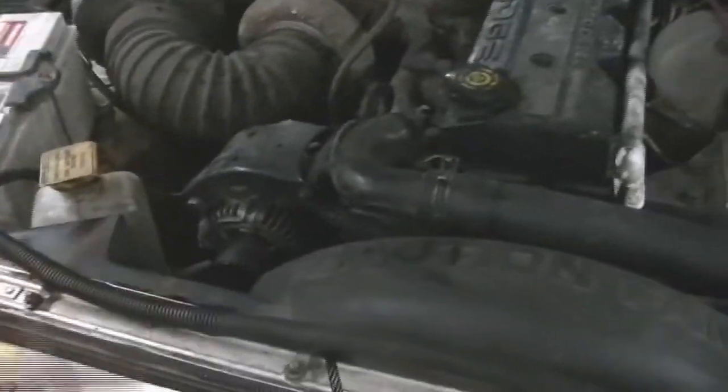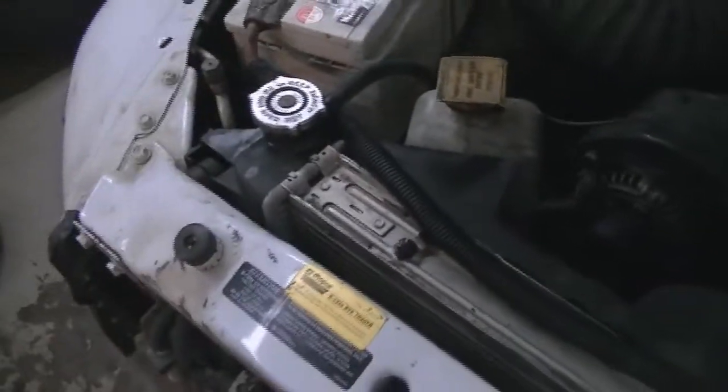It seems to be cycling and working as it should. As long as that leak stops, it should be a good sealed system. I had been really low on coolant before I noticed the heater core was leaking — pop the rad cap and you could barely see the fluid with a flashlight. Another thing: I busted my petcock, and that's what is actually leaking. I guess my pepper fix helped, but the petcock is still leaking, so I need to get a new radiator.